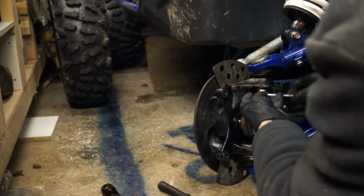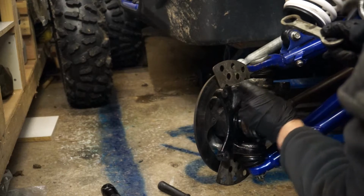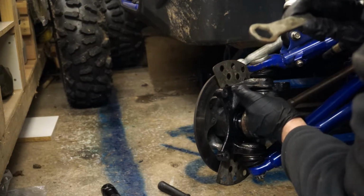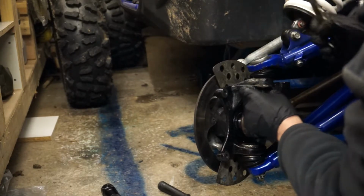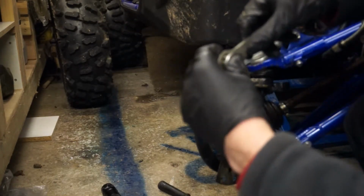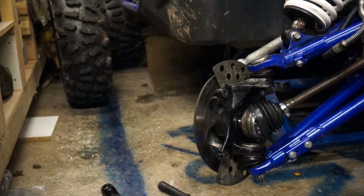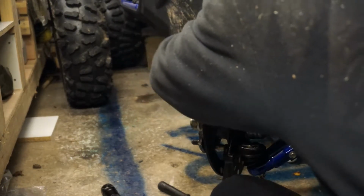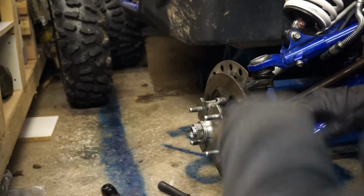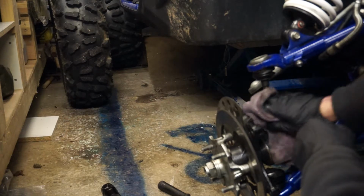32. 22mm that nut is. That's the big one. It's not particularly tight. 22 foot-pounds, something like that. It's neither here nor there, because it can't come out. That's all it takes to get them apart, unless you've got a really stubborn one, which is not very often.